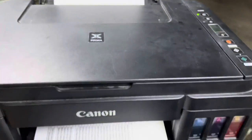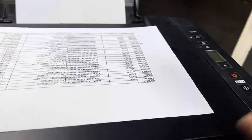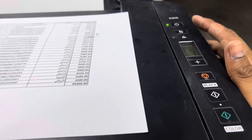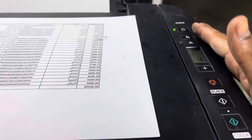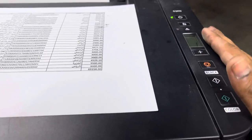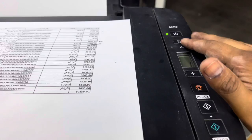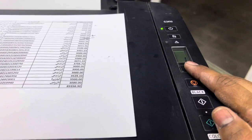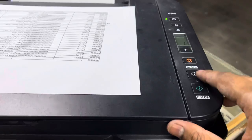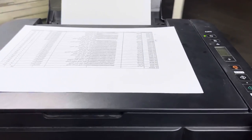You can do this flush process without connecting the printer to a computer or laptop. To recap: make sure the printer is in a ready state — the light should be stable with no errors. Press the settings button once, then press the plus button until it shows 10, and after that press the black or color button. The process will take approximately five to seven minutes.